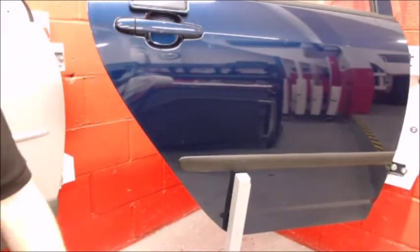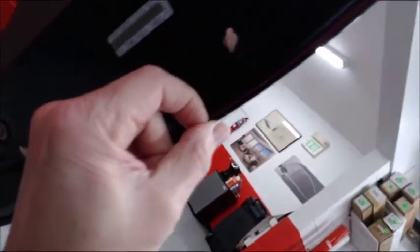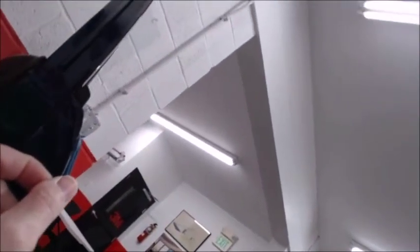So now that I've got it to the back side, I can now start wrapping it tightly, again with one smooth fluid motion of my finger all the way down. And you can even use your fingernail in that groove on the back side. There's usually a pinch weld there to press it firmly into place so that it won't come loose later.